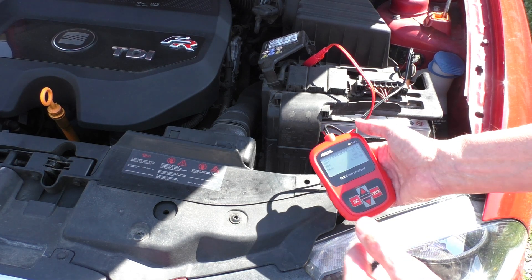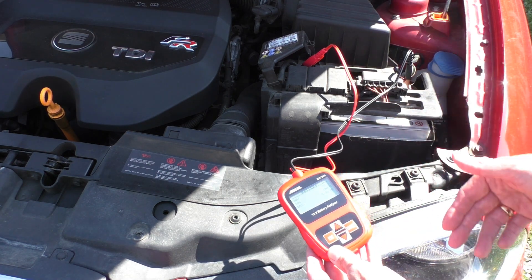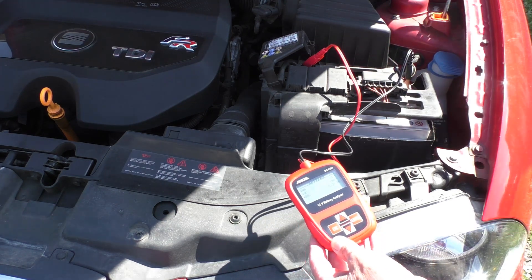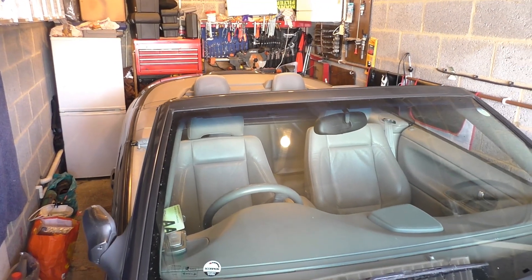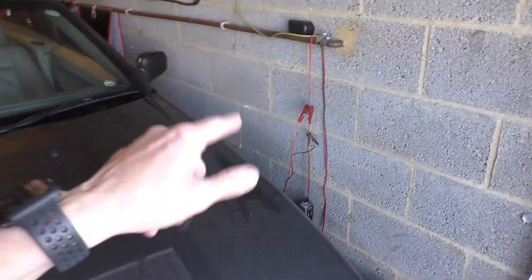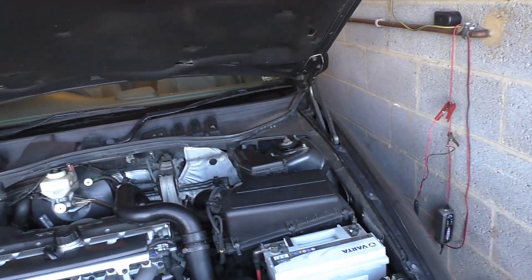This battery tests out good — I knew it would be, it's fairly recent. Let's move on to an older battery that isn't used so much. I have two cars. This is my summer car — slightly older — and it's not used in the winter months, so I have a battery conditioner on it to try and save the battery. Car batteries like to be worked — they like to discharge and be consistently charged.